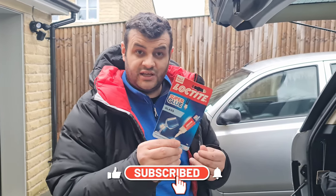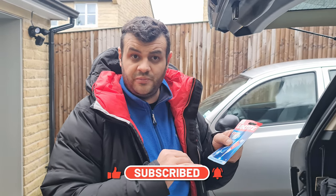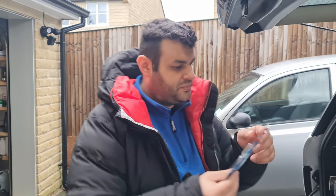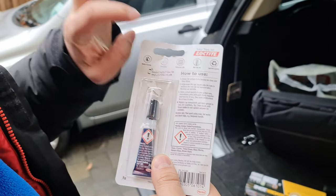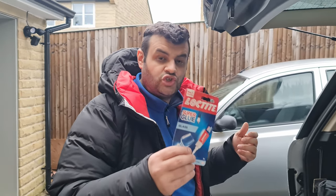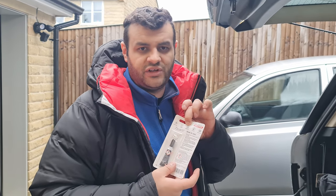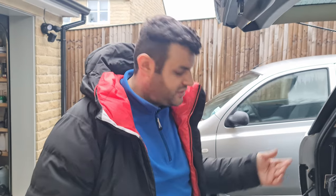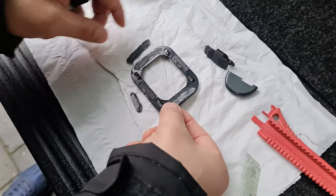For this repair I'm going to use this glue. It's not expensive — it's a transparent glue. I picked this specifically because it's transparent and it's dishwasher safe, which tells me that with condensation inside the glass it should work. This is a heated glass, so if it works for a dishwasher then it should work here too.